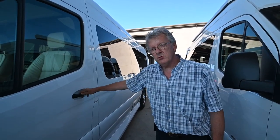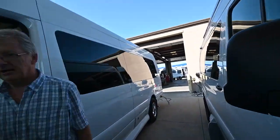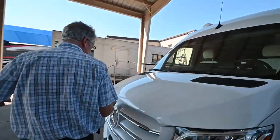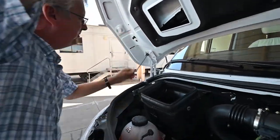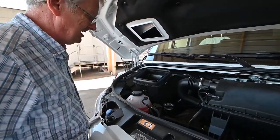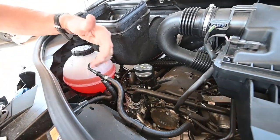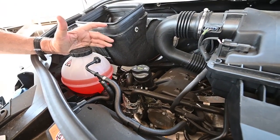Alright, so 2020 Midwest Weekender - we're going to go through it and show you the engine. I've got a little engine release latch here on the left-hand side, I'm going to pop that for the hood. I'm going to raise up the hood; I've got a little hood prop on the left side. Going left to right, there are a couple of checks I want to do. I want to make sure my engine coolant is full - that's a good level right there. This is actually called Mercedes Pink; if you were to add to this, that's the formula you use. You can get that at Mercedes or any of your auto parts stores.